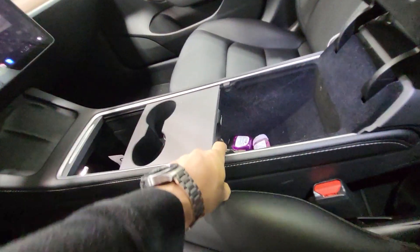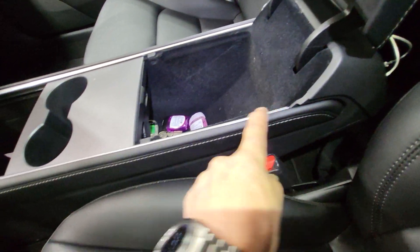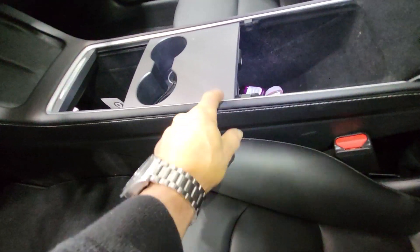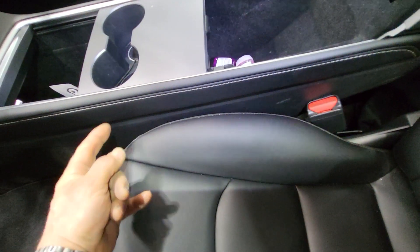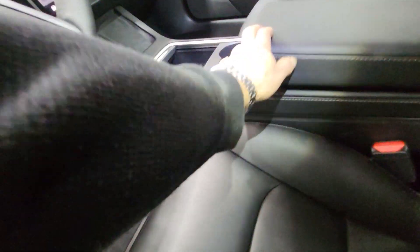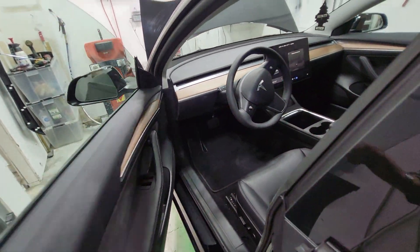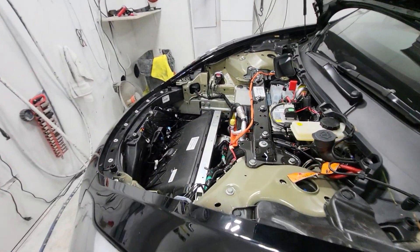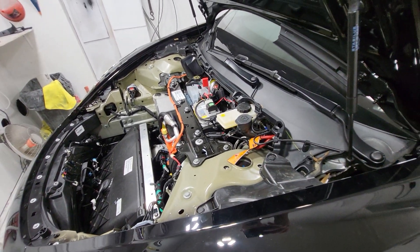There is another method where you access the cigarette lighter — this thing pops straight out, it has some clips all the way down, and there are some screws holding this trim piece. Then you can fish your wire up through here to the cigarette lighter if you want. But if you get a kit that runs on your phone via Bluetooth, you can control it with your phone, stay outside, and you don't have to go through the firewall — super easy.